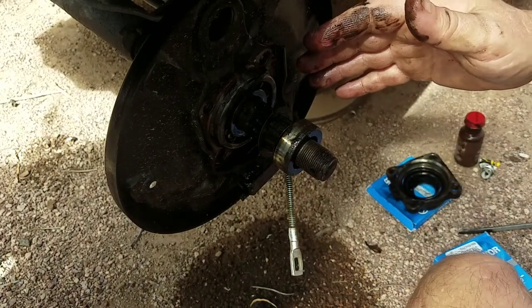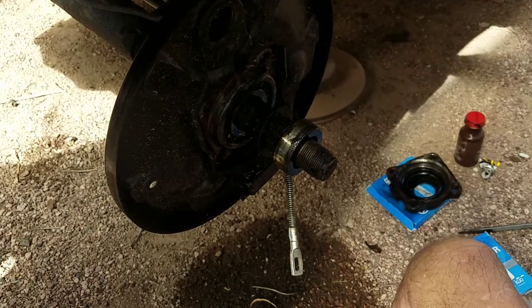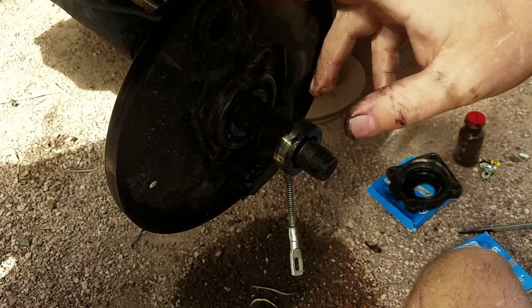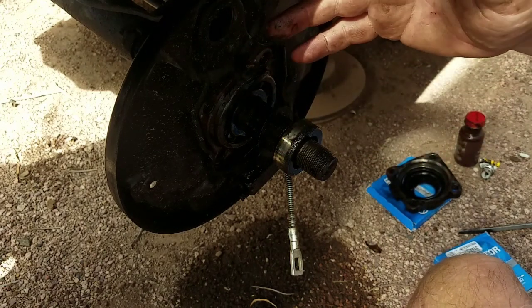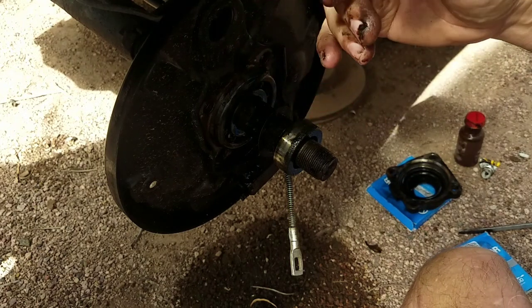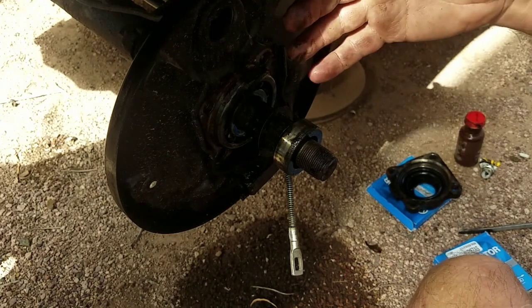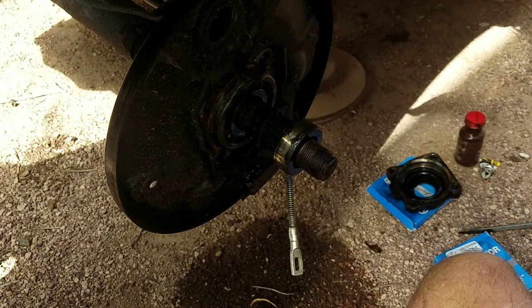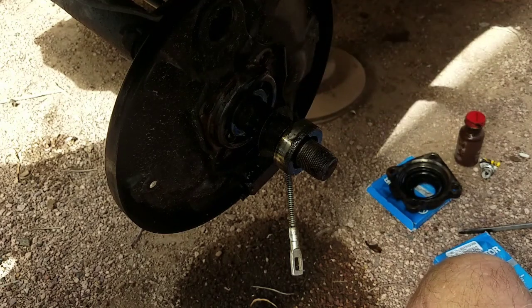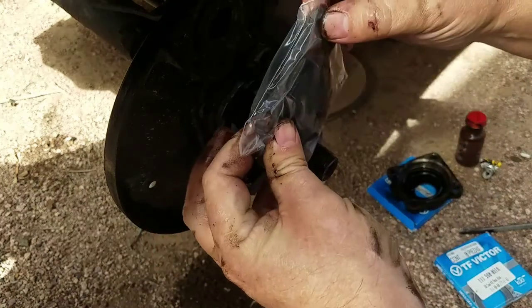That's more critical if you're building a performance bug. There's a bearing here — it's tight, it's not going to move. But if you have any slop back where the spade-shaped axle is and you dump the clutch on a performance engine with too much wear and it's not shimmed properly, it will shatter that axle. But if you've got a street-driven bug with a stock engine, just changing this and guesstimating the tolerance should be fine. That's why this really thick gasket has me a little worried.